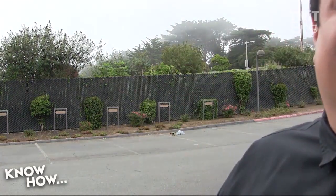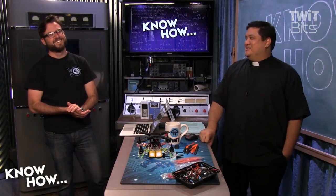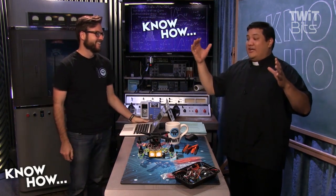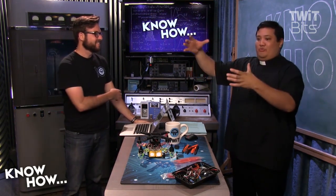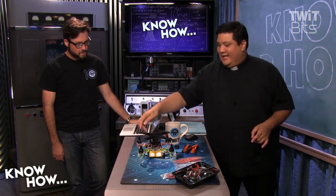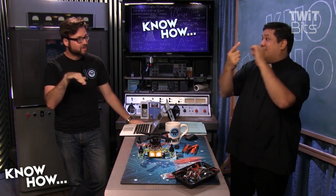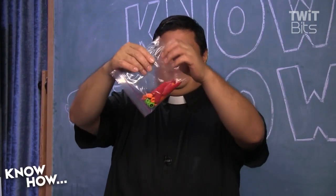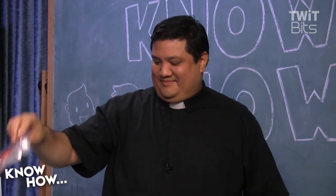Damn. So, issues? I knew you were in trouble as soon as it went off camera. I needed someone to follow — I couldn't keep it in frame. It was off the ground, but the weight just started doing this. The middle crash happened because I didn't secure one of the control leads and it came out from the frame — it got sliced by one of the blades. So it was only running on seven motors. That happened after it was already in the air. And the last crash hit hard enough that it snapped the frame off.